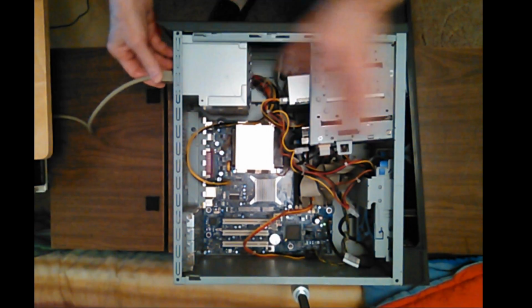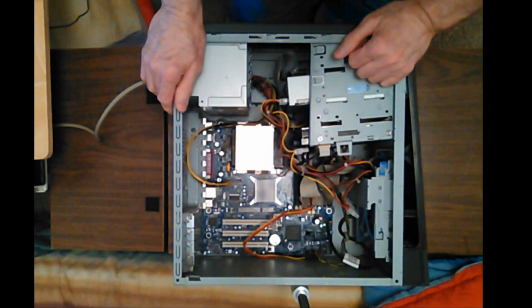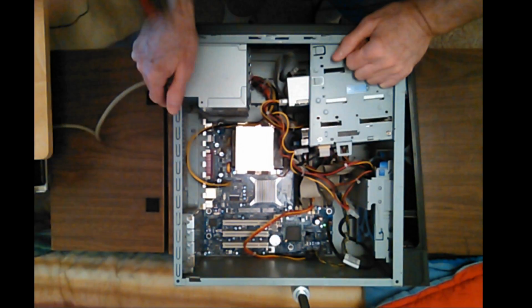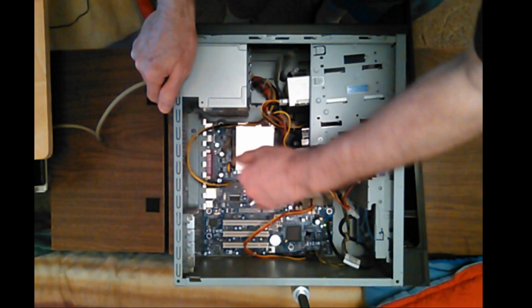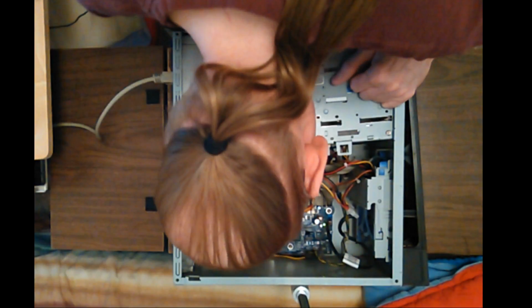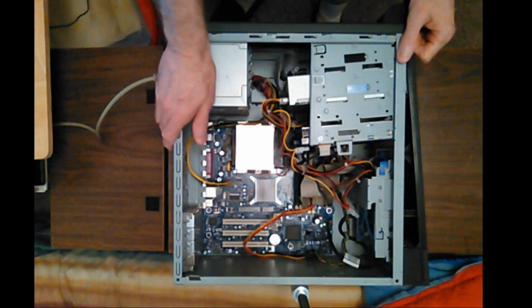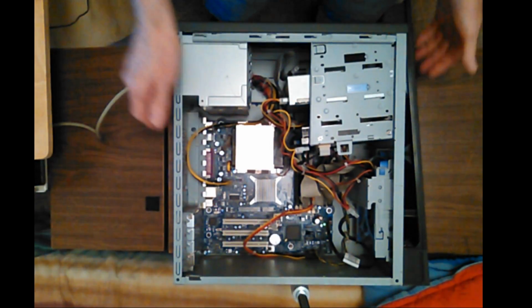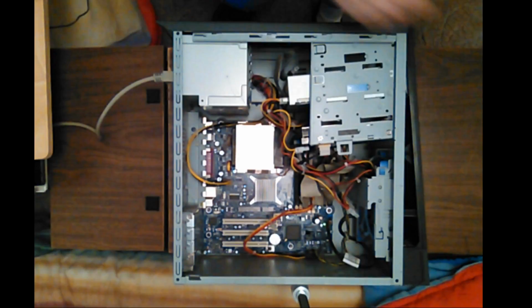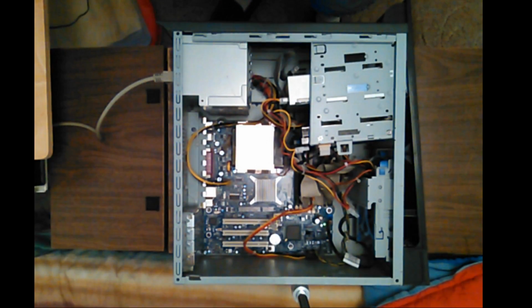So, okay, plug it back in and see if it's quiet without the hard drive. Well, it hadn't booted up yet, I don't think. If it has, it's the hard drive. Not sure if it's running. I think the lights are on, but I don't think anybody's home. Since I hard shut it down, it might have interrupted the startup. Yeah, there's no light on the front. There we go. It didn't automatically start up. Okay, I still hear that noise, so it must not be the hard drive.